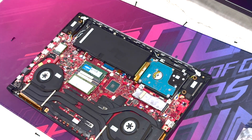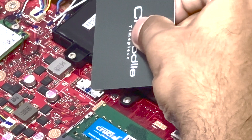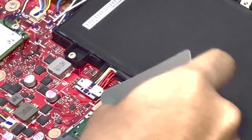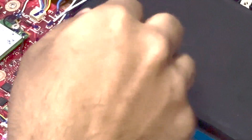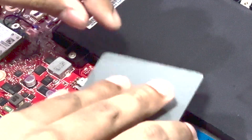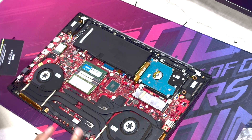Okay, I'm just going to put the back panel off to the side. Yours might look something similar to this. Whenever you open any laptop or device that has a battery, the first step should be to disconnect the battery. If you have a card you can use it to open the connector — stick it to the end and pull it out. Pull the pin towards you and then use a card to lift it up.